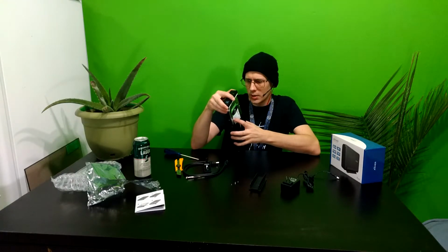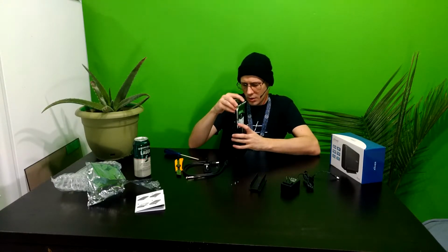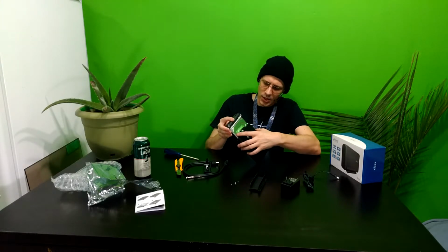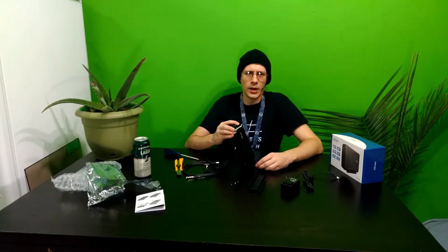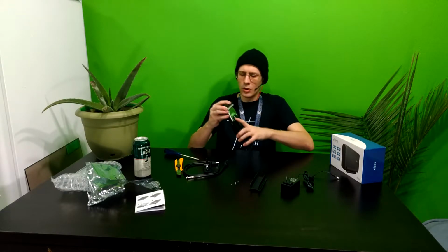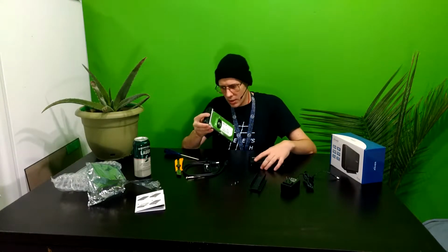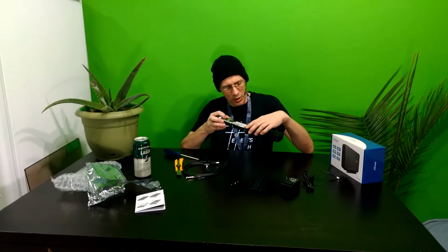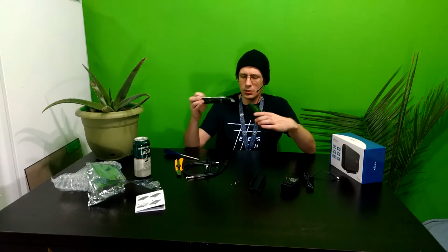I swear, that's one of the thinner hard drives or something, eh? Alright, so here's one of the problems I have with it, is that it just kind of sits in there, like rattled around. I think they need to put some more of this stuff on one of the sides, probably the bottom or something more, and the top should almost press right against it, so it can use the outside to dissipate more heat.